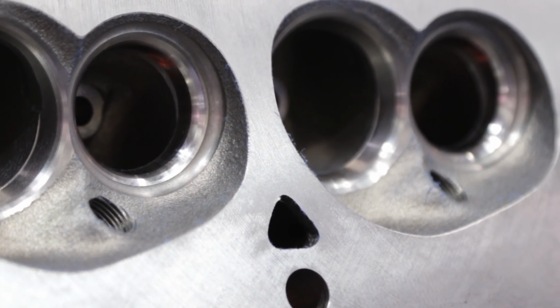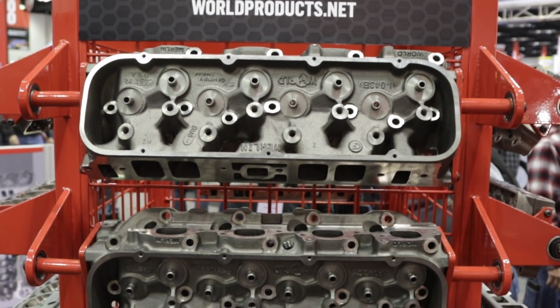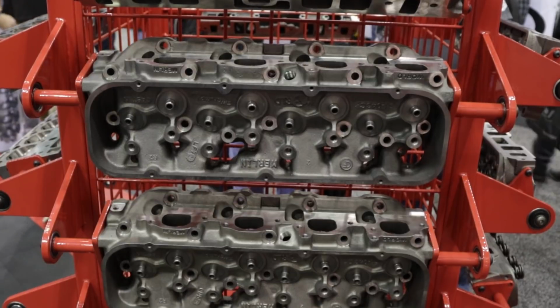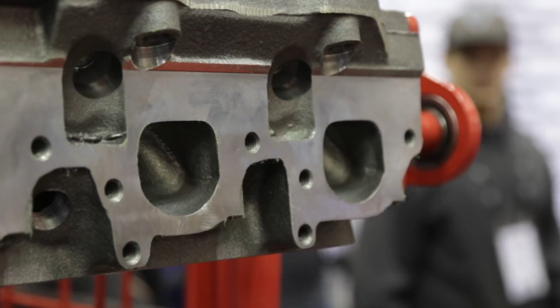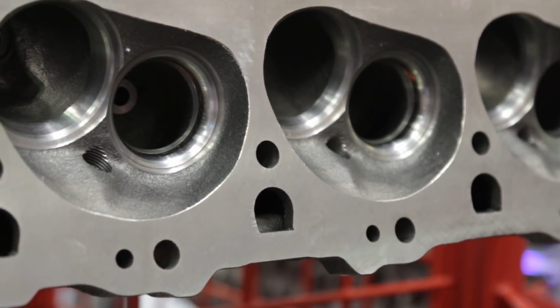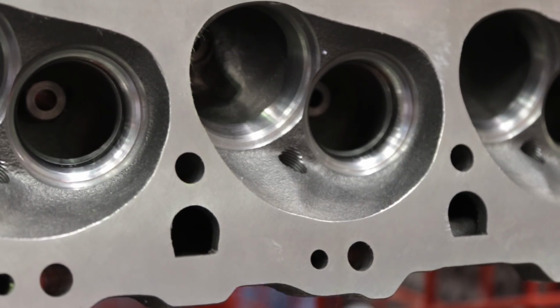Dick, one of the things you have is a great selection for the guys running the big block Chevrolets. Absolutely, Dennis. We have a 269 runner big block, which is smaller than anybody else has on the market. That thing works awesome, like on a 427, 454. If you've got a truck that needs a head that makes torque, that head works really good. Then we have a 320 runner that works really good in the 500 cubic inch boat market, 496, all of that stuff. We have a 345 for the big inch boat market or street market. Works really good on anything 550 inches and up. Same valve job on all the cylinder heads. Even the little 269 head uses a 2300 intake valve, makes a tremendous amount of torque at 2,000 RPM.